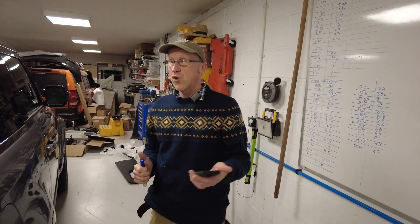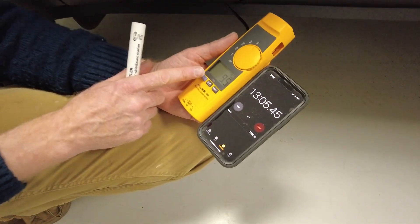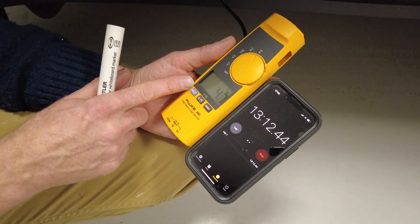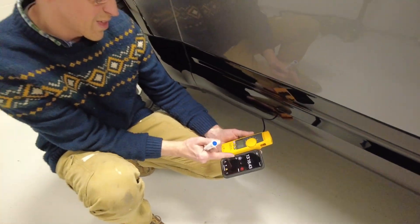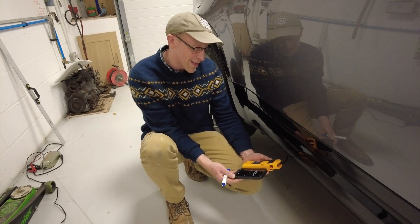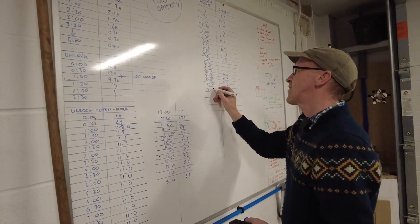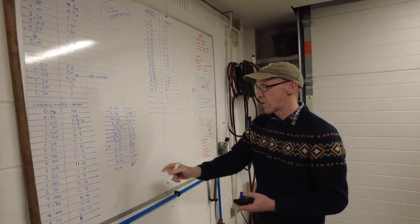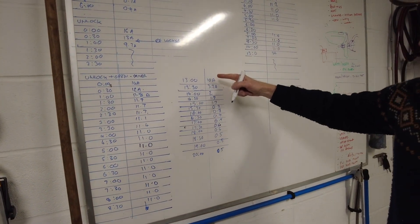Even with a low battery warning, even though the car should be conserving energy, we've opened the back door and we're still drawing 11 amps — which is like 120 watts of power. We've just caught it at 13 minutes and this seems to be the time when it's starting to fall. He's just gone down to 9.5 — it dies a slow and painful death at 13 minutes. That's exactly the same as what happened on the driver's door — it kept going at 10 amps and then at 13 it tumbled off.